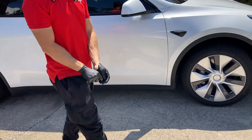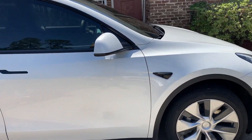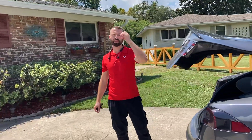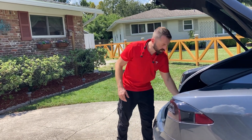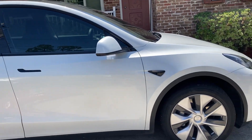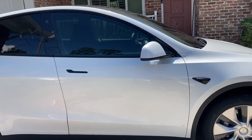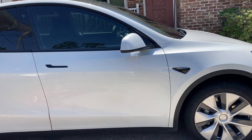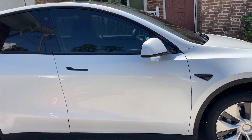About a month ago it came up and said your back tires are low. So you have rear wheel drive? Yeah. On the rear wheel drive model — Y or 3 — it's recommended to do a rotation around 6,250 to 7,000 miles. So you have 40,000 miles and your rears are gone. Have you replaced any others? No. That's not too bad, but if you would have done rotations, you probably could have gotten 45,000 to 50,000 miles — a little bit more.